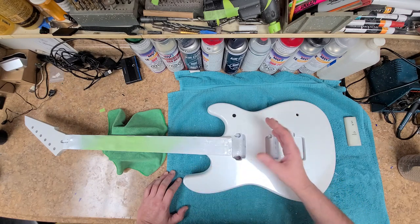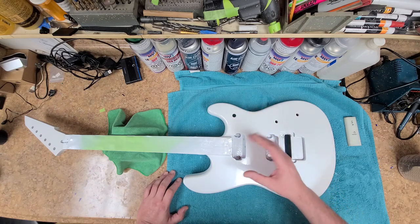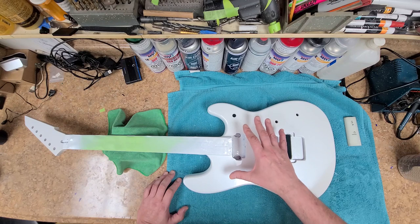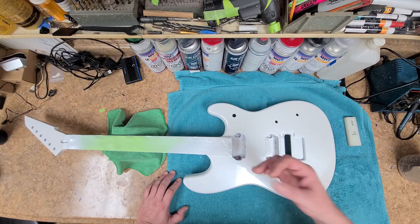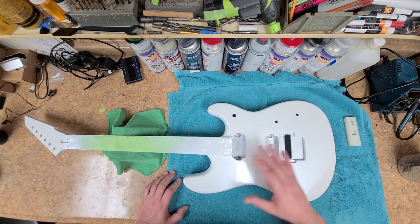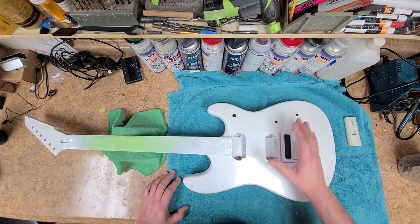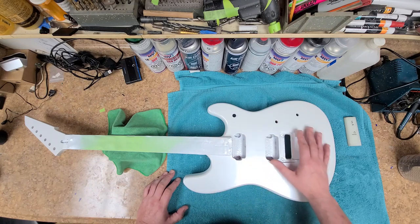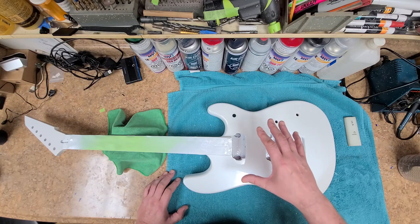I re-sprayed the primer in some of the bare areas after feathering out those areas, so it doesn't show a line, a mark, a circle, or a ring. Feathering out those areas and re-spraying with the primer, and then sanding the primer down with 800 grit sandpaper — wet sanding — that way it gets any bumps, dirt, or anything that ended up being in the primer from showing up when I put the color on. If you have a pimple or a bump in your primer finish, sanding that out first, wet sanding it, making everything nice and smooth.